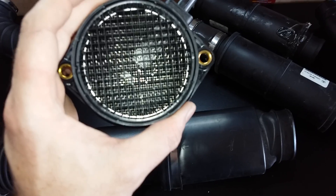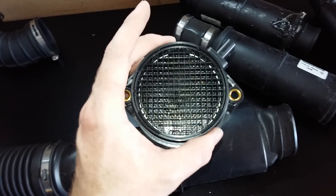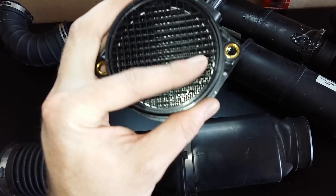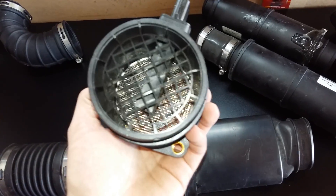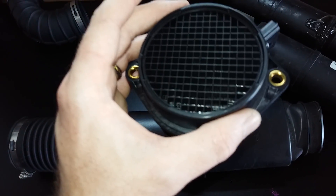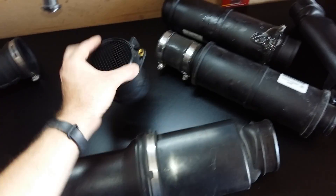When I see people on any kind of forums — no matter what kind of vehicle it is — the only people that have performance increases... like on the LS6 or LS7 Corvette engine, the first thing everybody does is put a ram air intake system on, but they don't see any kind of increases. Same thing with my Mustangs — I never saw any increases until you put an aftermarket airflow sensor on there that was straight through. There was no benefit to putting a cold air intake on any of the race cars or performance cars I've driven or modified. I use those same principles here that I learned in my Mustangs and Vortec LS engines — and I just modified my own sensor. That's where I got most of my gain; my towing pulling up hills improved from removing those restrictors. That was a big restriction right there.